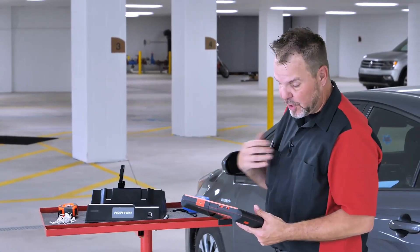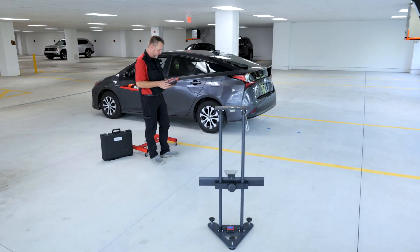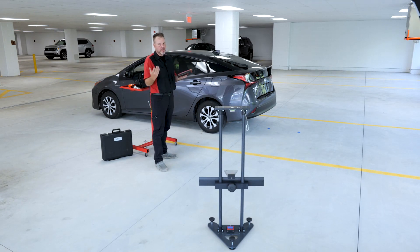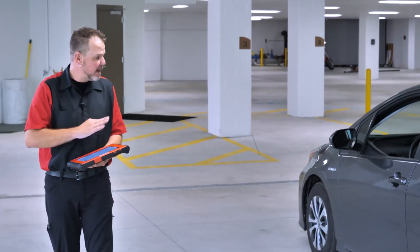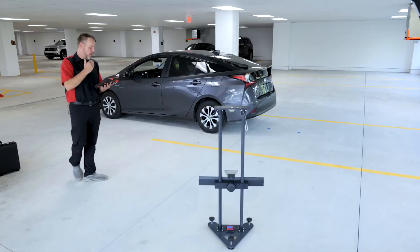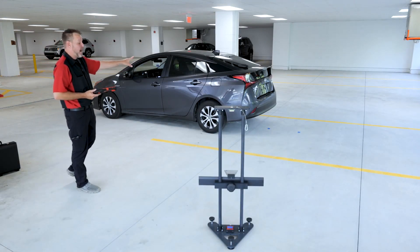Now we're doing the actual calibration. Do not turn off the scan tool, do not move or shake the vehicle, and close all the doors. The specification we're looking for is negative 3.6 to 3.6. If it's not within specifications, make sure you set everything up correctly and make sure there are no reflective materials around. I'm going to move the ADAS Link stand out of the way. I have no metal objects around me and I'm out of the way enough to press continue. It's gone through its calibration — 0.0 is what we're showing on our screen, which means successful calibration. Everything is within spec and the blind spot monitoring system is operating as designed. We would next repeat the procedure for the passenger side.